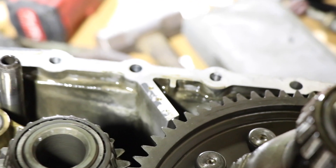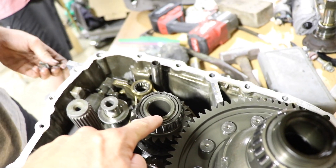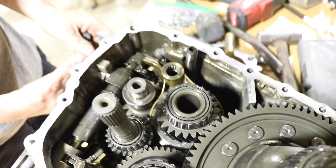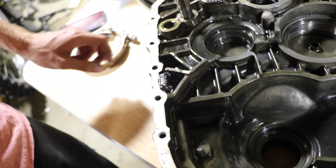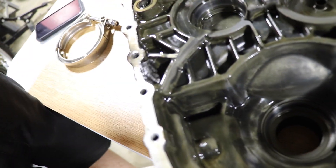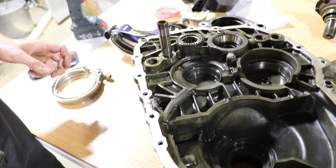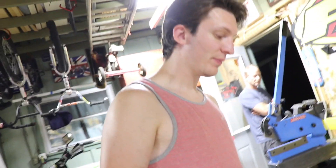There are little spot holes all over the trans. That's a huge support piece — no wonder it flexes. And there's a magnet in there — it's not a drain plug. On automatics they're usually just laying in the pan; here they're just catching debris and leaving it in there.